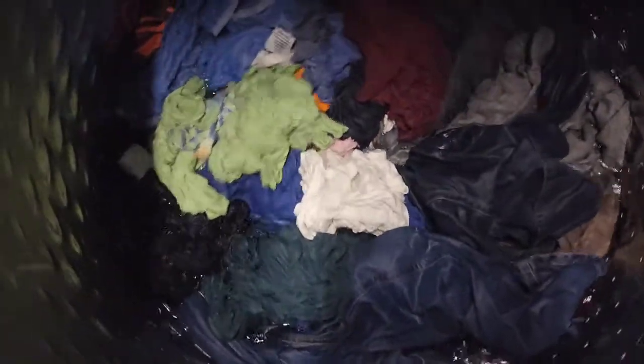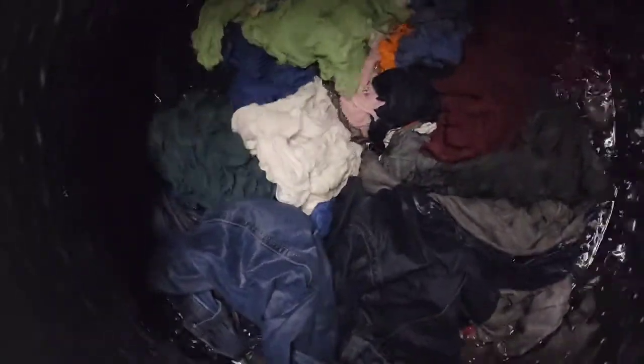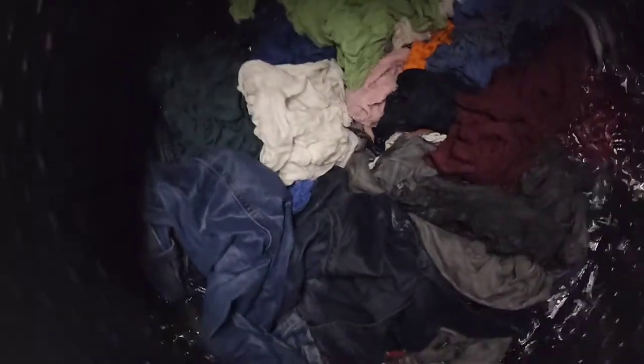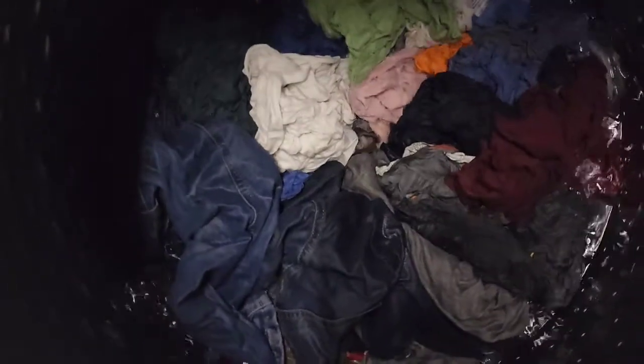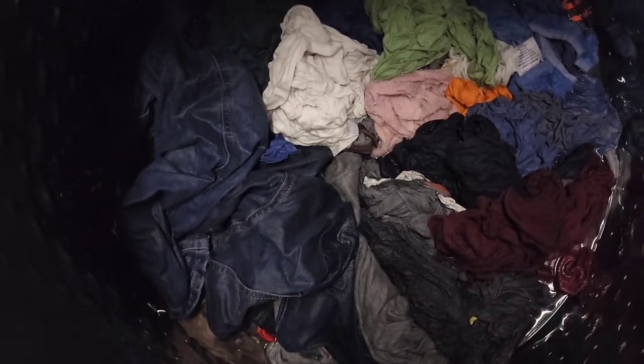If you think about a front load washer, the only agitation that happens on a front load washer is the clothes rolling over themselves, and that's how they get clean. So this is kind of a mixture of the old way of doing it with an agitator and plates and fins, and the traditional way with a front load washer where the clothes agitate on themselves. And you have 4 different ways that that plate on the bottom will move them. It'll move them quickly, it'll move them slowly, and it has some pulsing that it does. And then it'll stop and add a little more water as it goes.